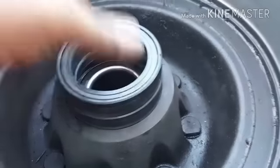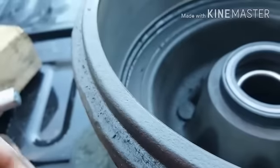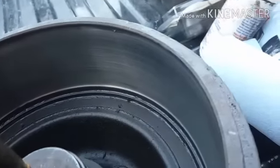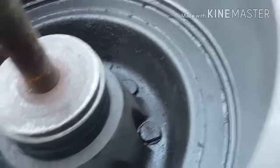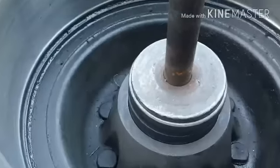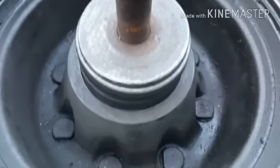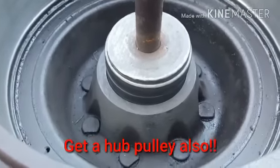A good idea to take your old seal and use it as a guide. I got a dude to make me a seal driver — this right here knocked the races out and everything. It fits right in here like this, and then you can easily put it back over there. You don't want to hit these too hard — if you hit them too hard, you bust the seal before you even get it in there. As soon as you put the seal in and add oil, you're leaking because you hit it off center. That's a good seal driver. The dude charged $20 to make them at the trailer shop. They make a puller too, which is good to have on the road. Let me knock this one in and show you how it looks.